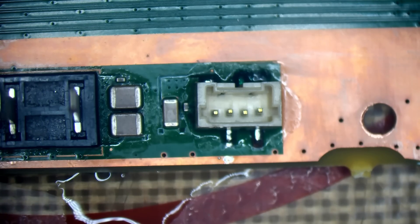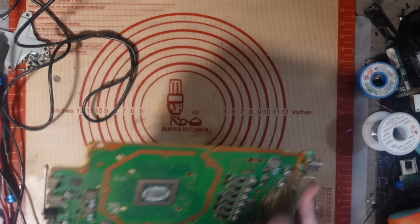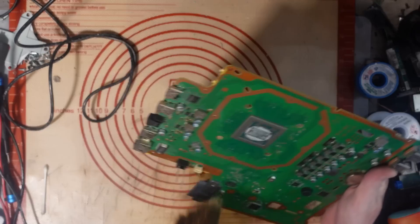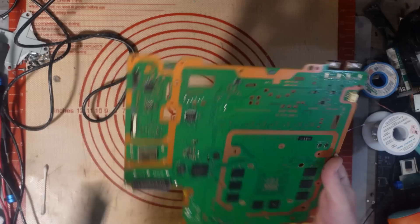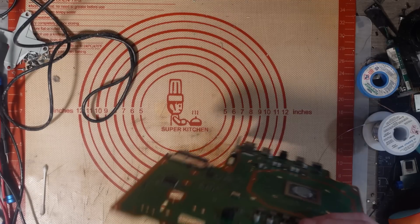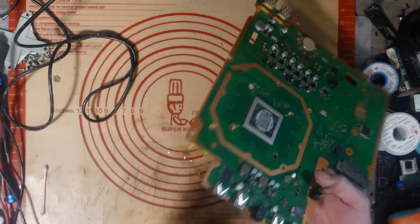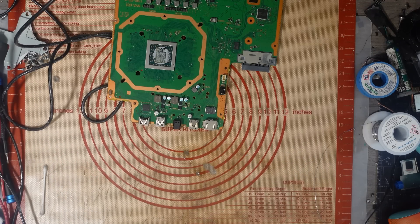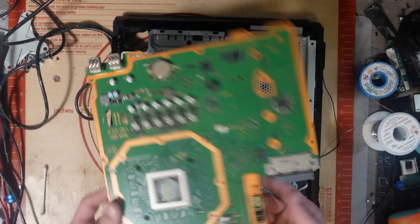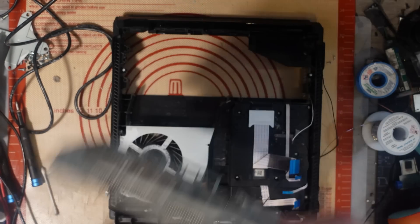I have a brand new paintbrush so I can clean this thing properly. It looks like someone attempted to service this, damaged that connector, and just gave up. It doesn't take long to clean them when you're experienced. Someone who's never done it before would probably take twice as long. I've cleaned hundreds of these — it takes about five minutes. My little motto is: if I ever take a console apart for anything, I'm going to service it no matter what unless it's just been done. There's actually not that much dust in this — all good.